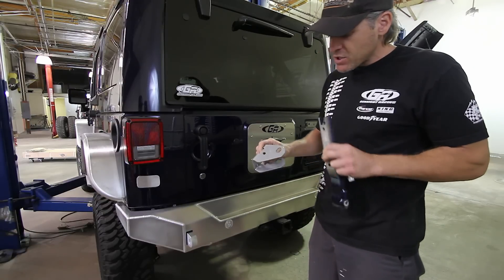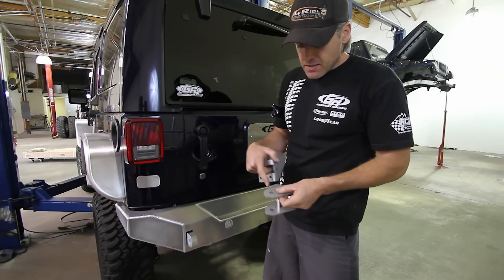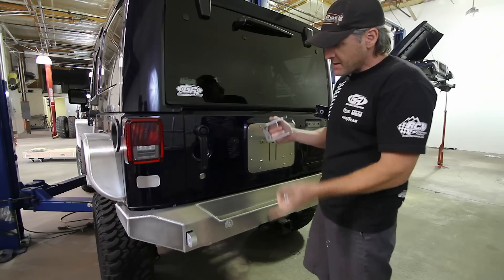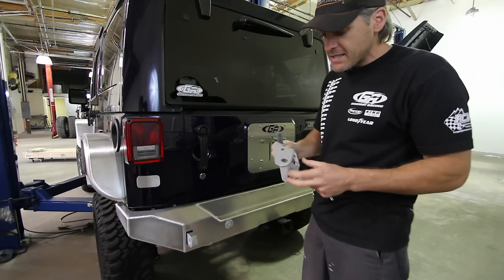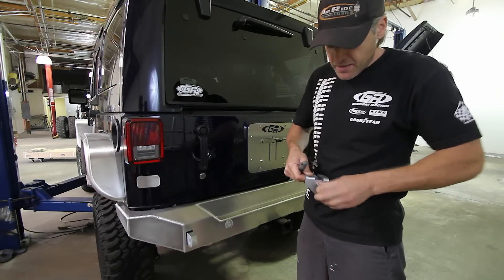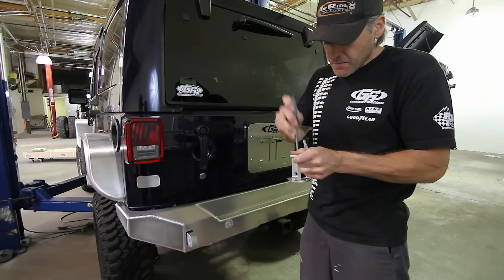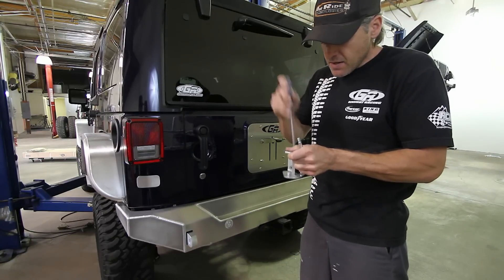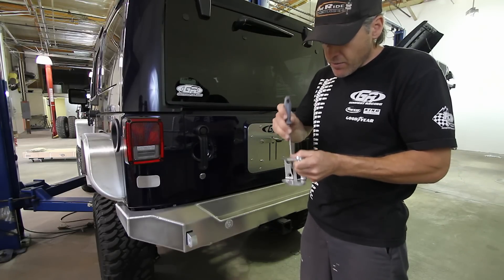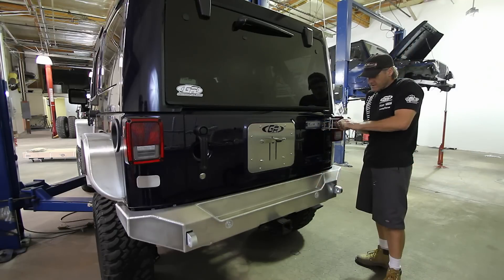There are actually two different brackets — one that's slotted and one with a solid normal hole. Use the slotted one on top because that's your adjustment for aligning the tire carrier when it closes. Powder coating is nice but the thickness will likely prevent parts from passing through, so you'll want to remove that thickness of powder coating until the bolts go through the bracket.